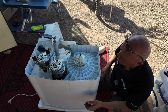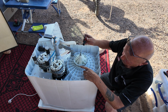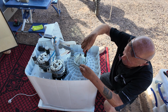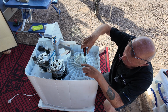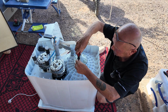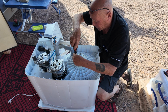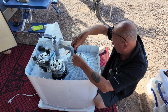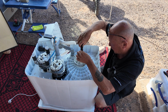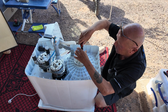Okay, if you need to remove the gearbox, you can actually leave the pulley wheel on. You don't need to remove the nut and take the pulley wheel off, because you are able to put a screwdriver in and then remove the screws all the way around. I suggest undoing them and doing them up on an even basis. This stops anything coming out incorrectly. And when you're putting the new gearbox in, you will bring the gearbox down level by doing it alternately.